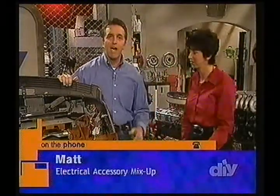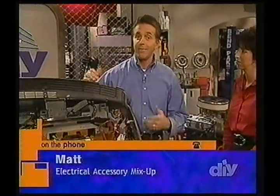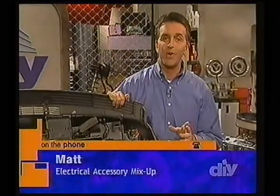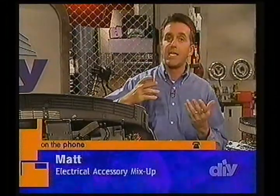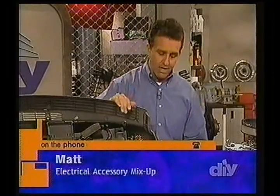Certainly. What comes to mind is the fuses. Obviously, when you have anything happen where there's a pop and a flash, either somebody's in the car with a flash bulb or you've got a fuse that blew. And the situation going on here sounds like that cigarette lighter somehow has become loose, or a connection on it has become loose, and something arced. Now, the arc by itself could create a flash, but more likely you've blown a fuse.